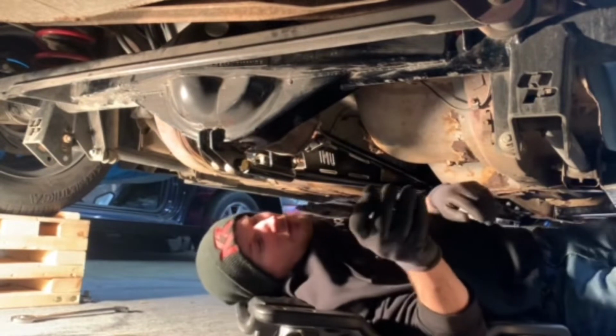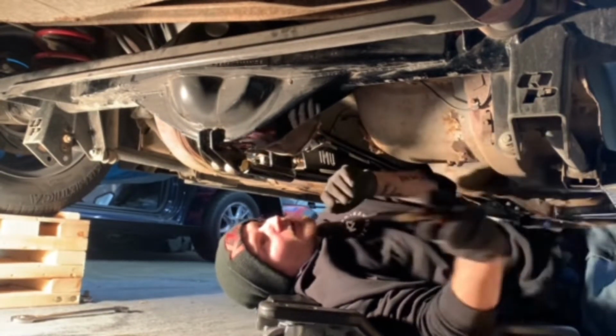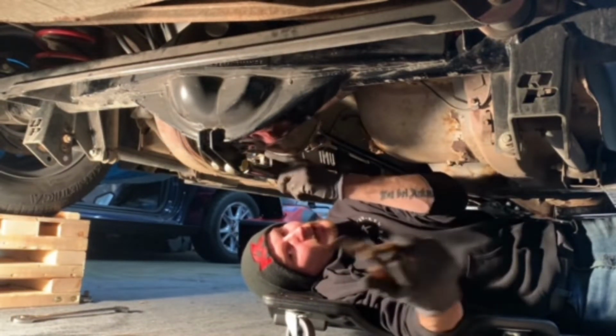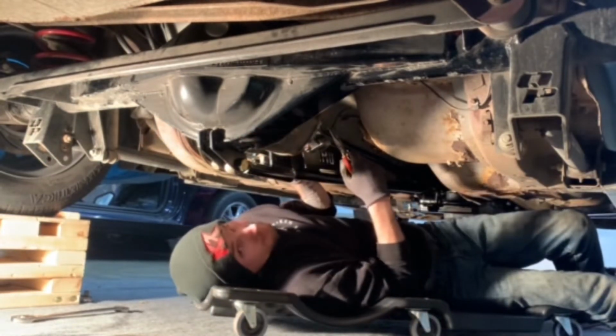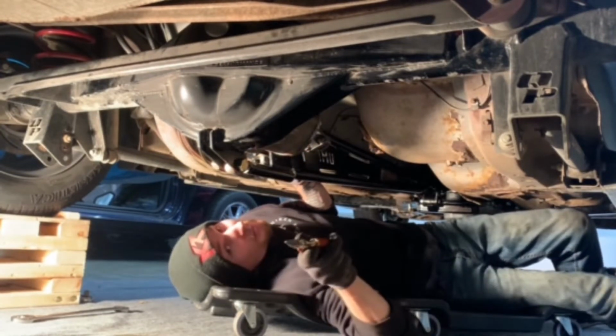Helpful tip: if you have a 3rd gen Camaro with a Ford 9-inch and Quick Performance, they're going to send you the torque arm adapter piece. I don't know what to call it. Make sure you clear the tunnel as much as you possibly can. You'll thank me later.